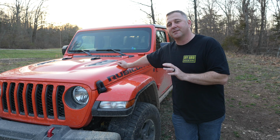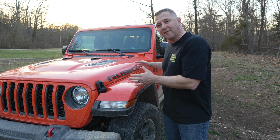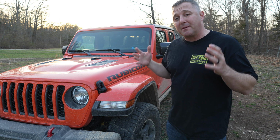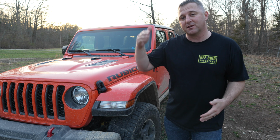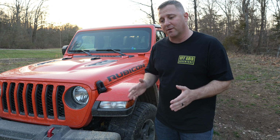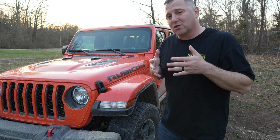Don't get me wrong, I know this is a Jeep and it's meant to go off-road. And so another thing that I've realized as I've started wheeling with my Jeep is that having the wheels extending a little further prevents some potential body damage when you're out getting close to rocks. What I mean by that is your wheels, your tires, and possibly your fenders will make contact with rocks that are to your left and your right well before your body panels would. But if you're in a traditional SUV, for example, something like a 4Runner, where the tires are under the body and frame, I believe you're more likely to potentially damage the sides of the vehicle in those extremely tight places.